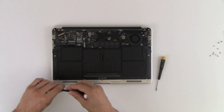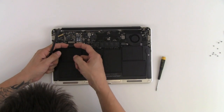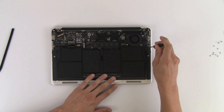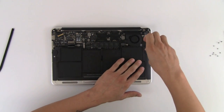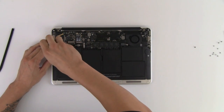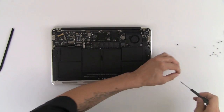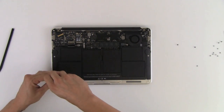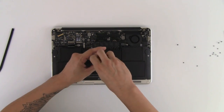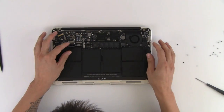The first thing we're going to do is unplug the battery connector, and that'll lift straight up. Lift it out. There are five screws holding down the battery and they're all different sizes, so be sure the screw you take out goes back in that exact same hole. Now the battery will come out — it's not connected or stuck to anything else on the unit.